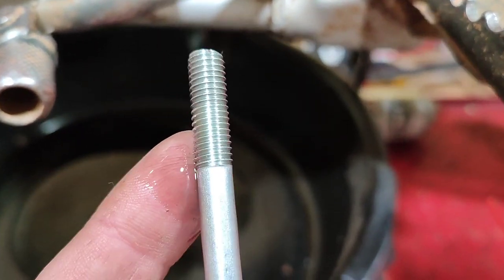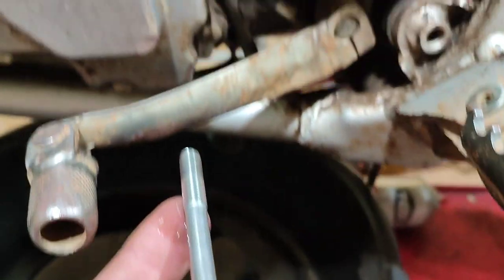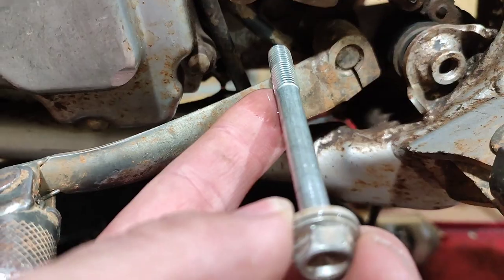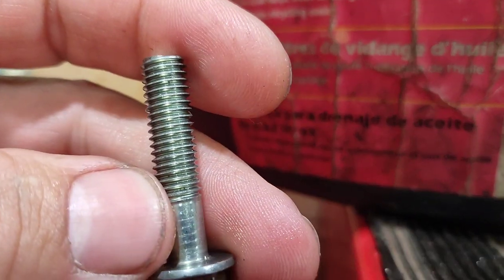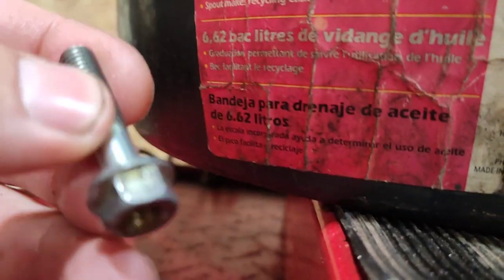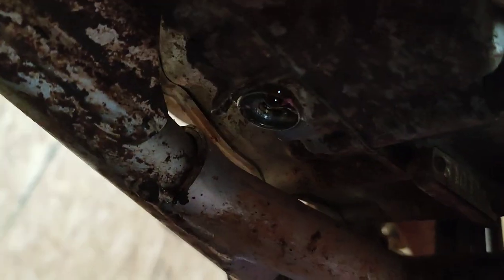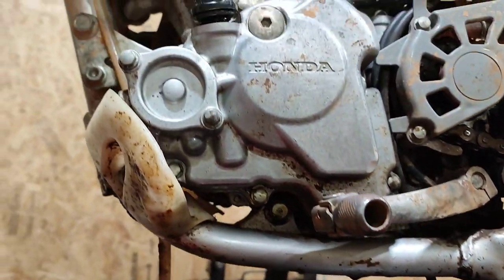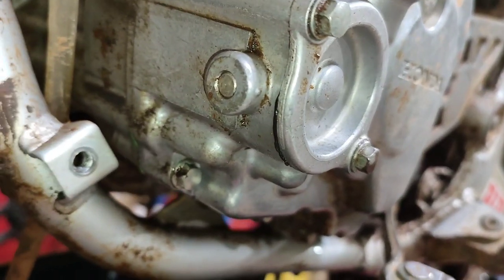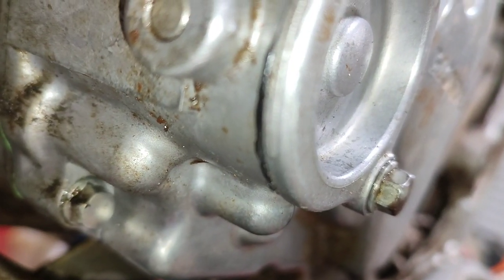It's a big deal if you strip these and have to re-tap them, so don't strip these. This is the one that comes out of the side right here. And this is our engine side drain bolt. The crush washer looks like it got stuck up in there, so we're going to have to get that out. Let's pull this cap off. With that front guard off, you can see that better now — you can see that gasket sticking out of there. That's going to leak like crazy.